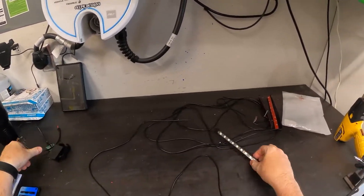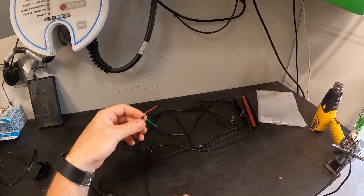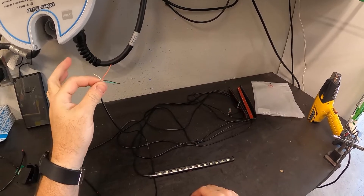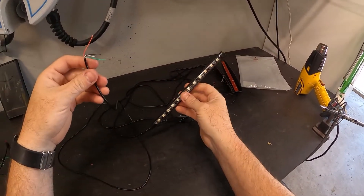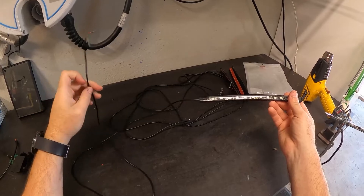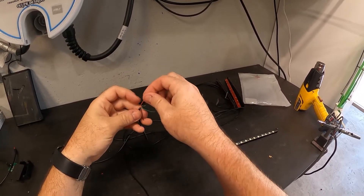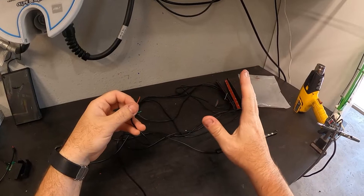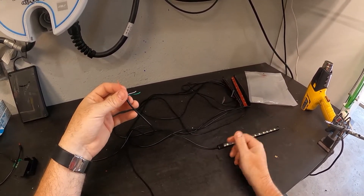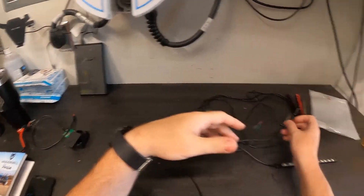I cut all that off because this controller is worthless to me. These LEDs are 12-volt ready anyway, so I'm just going to wire it all up on my own. I just want them to be red — I don't care about other colors or making them dance to music or any of that. I just want red interior lights. I'll figure out how to lay these out in the cabin, cut and splice them, and make my own little harness. I'll run ground to the ground in there and run this up to an unused switch on the dash.